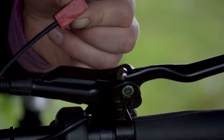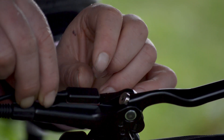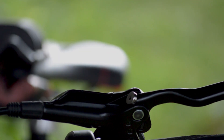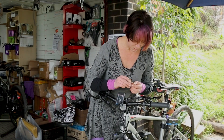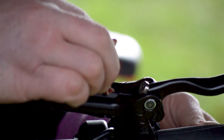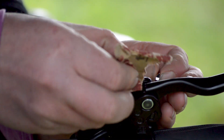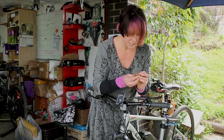It does come with double-sided tape — don't trust that. It's going to vibrate loose, and often when it's cold or hot that glue will give up. So we use two-part epoxy. The first stage is to use a bit of sandpaper to scuff up the surface a little so the glue will bond better — just on the surface where we're going to apply the glue, and also on the lever itself where the magnet is going to go, and even on the magnet itself.